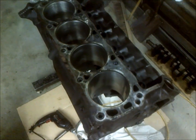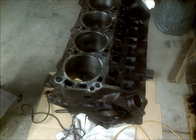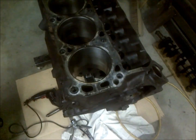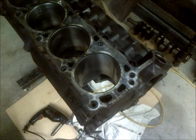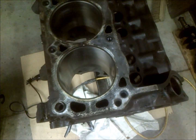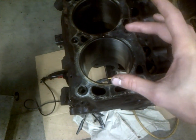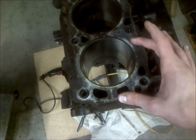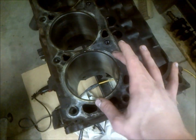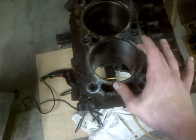I wanted to make mention of honing because I don't think a lot of people do the right thing with it. The only time you can hone a bore is if your cylinders look relatively good and when you measure them out they're close to whatever bore you're shooting for — so that you're able to run standard pistons with standard rings again, or else it would never seal up right and it'd pass oil pretty quickly.